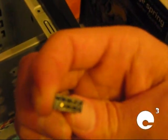And with USB 2 connections, the standard, well, USB 3 in this case, it's all the same. But anyway, when you're plugging in your USB cables, the typical color code on USB cables, I'm going to go ahead and show you here. You see there's a spot where there's no hole for a pin. On any USB hookup on a motherboard, you have a spot where there's no pin, and there's a pin for a ground. And the standard, going from left to the ground, is red, white, green, black.